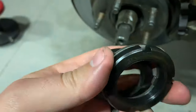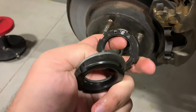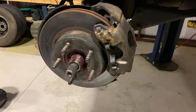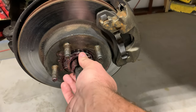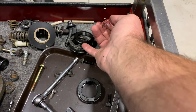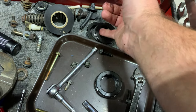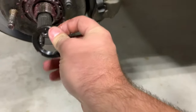Here's the conversion kit — just these three pieces. The nut on here that has the pin built into it goes on first with the bearing repacked in there. So this will screw on — we won't need the old nut again. We've packed some new grease in there and it's been cleaned and packed now, so we're going to slide that in place. On the conversion, you want to grab the nut with the pin on it. There's the pin — so now this just screws on like this.